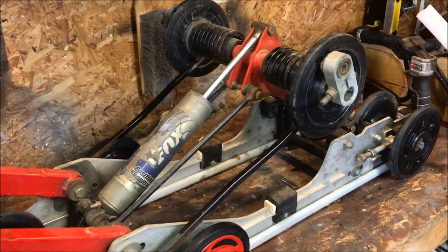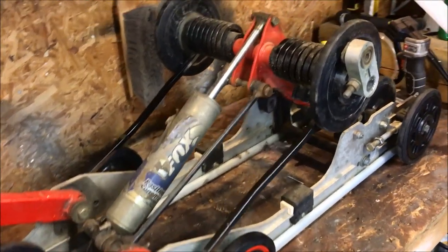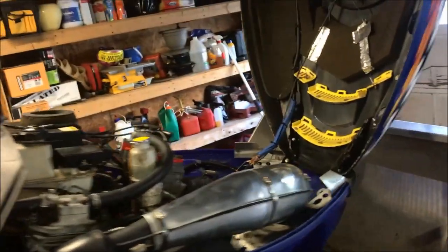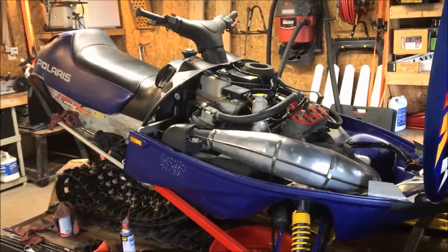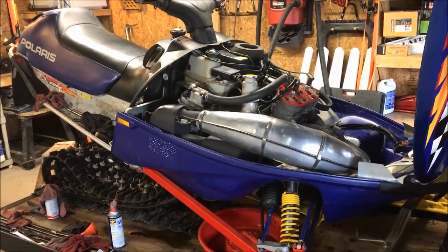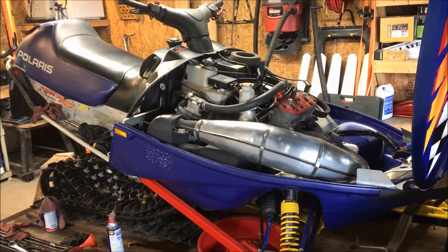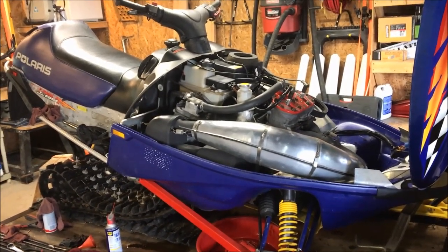By collapsing the springs you'll be able to get it on there, then just lift the springs back up onto the blocks when you're done. That's essentially all you need to do to change a track on an edge chassis — it's really not that complicated, mostly basic hand tools. Take your time; if it's your first time, grab a buddy so there are two sets of brains to double-check everything. If you found this helpful please give a thumbs up, subscribe, and leave any questions or comments below. Thanks for watching and have a great day!